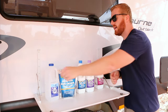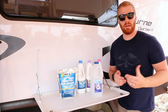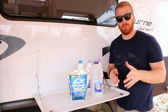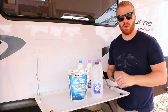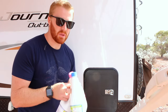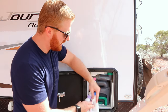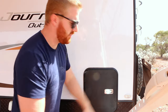Two final toilet tips: I carry a washed-out empty two-litre milk container in the van. When setting up the toilet I just open the flap from inside, drop in a sachet, fill the container from the tap, and pour it in — quick, easy, no need to go to the exterior hatch. Also, to prevent the chemical odour getting through the van, I store the chemicals in the small gap between the canister and the external hatch — it keeps them sealed off from the inside of the van.